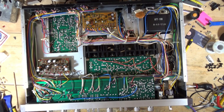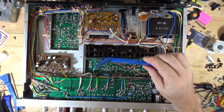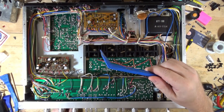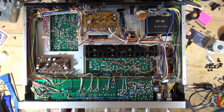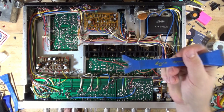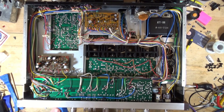First I'm going to remove all of these knobs. Here's the tool that I like to use — somebody asked me if they were having a hard time getting a knob off their receiver. I bought these a long time ago for car stereo installations. You just use this to pry — just a little pry tool. Pry it right off.